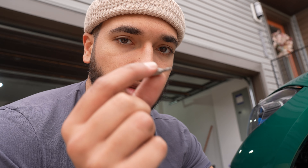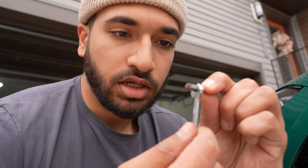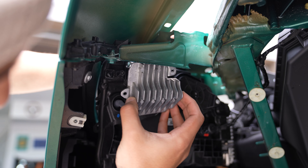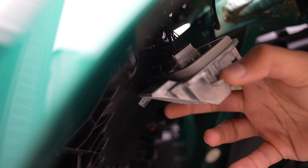Now that we've got the fender liner out, it's just a matter of taking a T20, loosening this up, and getting this panel out as well. That last screw up at the top was very hard to take out. What I ended up doing was finding a very small T20 bit — the only thing that would fit between the bolt and the frame — and then using a tiny wrench from the bottom side, grabbed it on, turned it, and took it off.